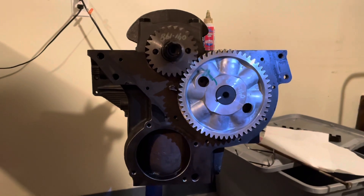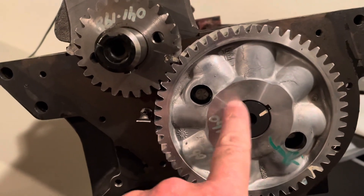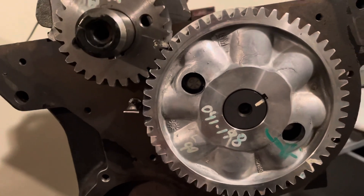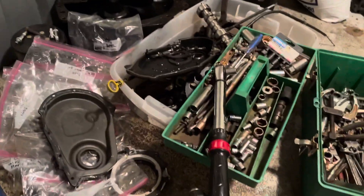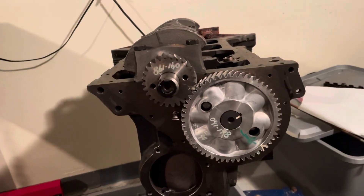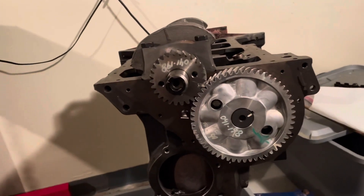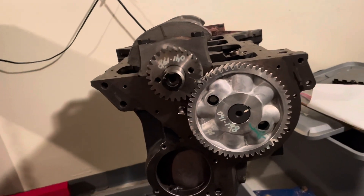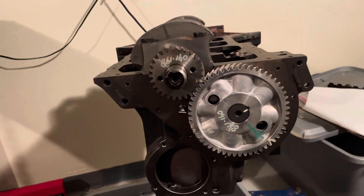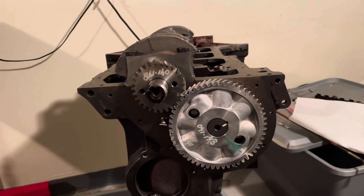The cam retainer plate bolts are tightened to 80 inch pounds — that's not a lot. I have an inch-pound torque wrench and I just finished tightening them up to 80 inch pounds. The next step is to put the timing cover on, then get the harmonic balancer installed and test the tool I built for that — I bought new 8-inch long bolts instead of 6-inch, hopefully that'll make it work. That wraps up the installation of the cam on a 3.0 liter Mercruiser four-cylinder engine. Thanks for watching.